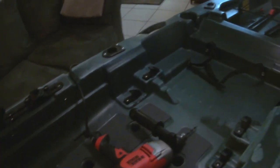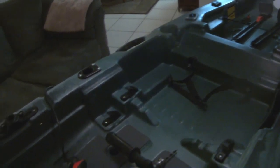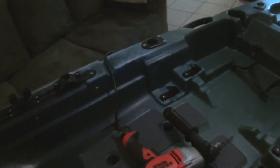When you get the rudder kit for this kayak, you're going to get color instructions as well as a parts list. I went through the first couple steps — on both sides I removed the foot braces as well as the rails they were on. This is a good time to clean underneath to get any sediment or residue from normal use. Each foot rail has three screws — set them aside because you'll need them later.